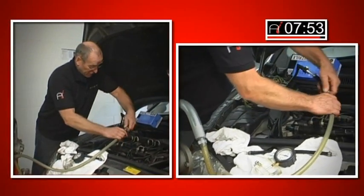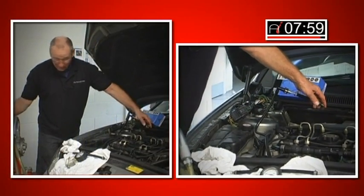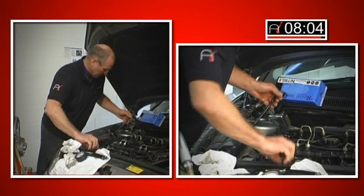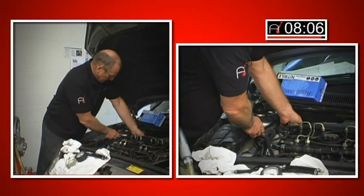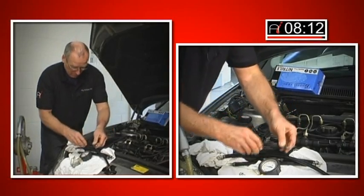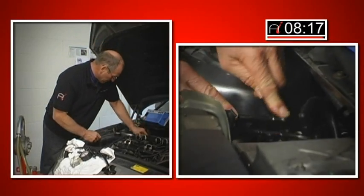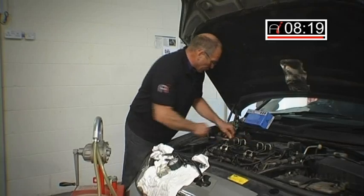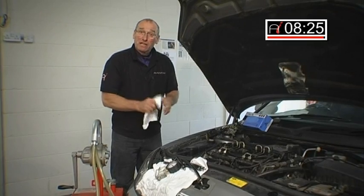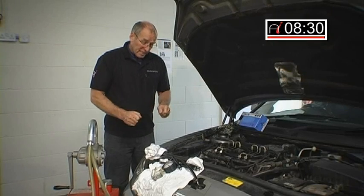Of course, when the process is finished, once again it's self-sealing — there should be little or no spillage from any of these hoses. Remove the temporary adapter, remove the hose off the fuel filter, and reconnect the original hose to the filter and push home the clip. That now should be fully primed. So let's go and give the vehicle a crank and see — it should start within a few seconds, which equally is important, keeping the high-pressure stage fully lubricated by the fuel itself.